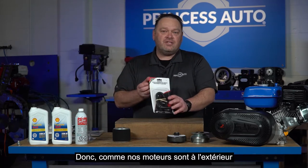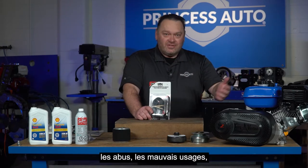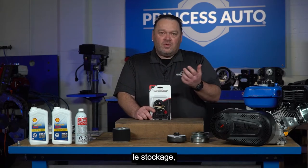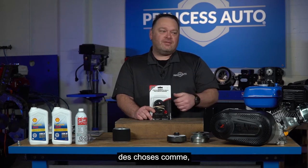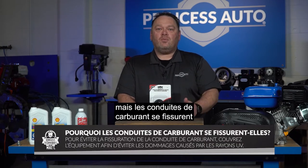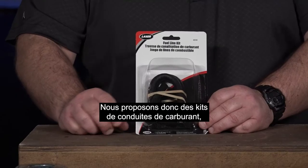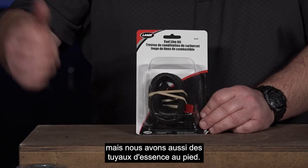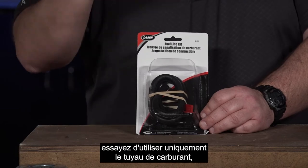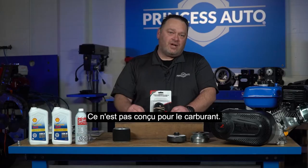Supplying the fuel — as our engines are outside, weather, heat, abuse, misuse, storage — components do wear out. Fuel lines will crack over time or split; they may get clogged. We carry fuel line kits, and we also carry fuel line by the foot. If you choose to buy it by the foot, try to use fuel line only — don't substitute with PVC piping or tubing that's not rated for fuel. These are rated.